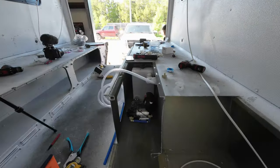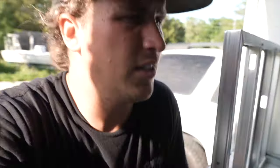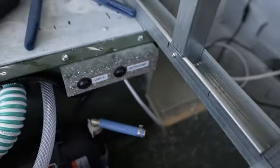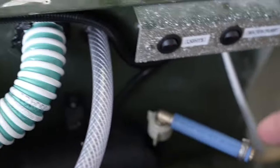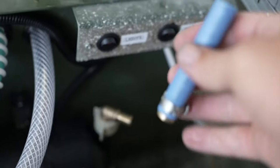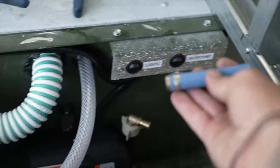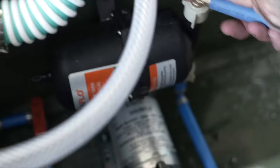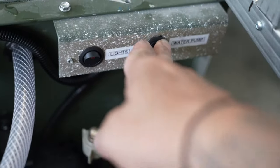Fast forward — I went ahead and fixed the plumbing issue, I hope. I'm filling it back up with water now, so this is the moment of truth. Let's just hope this fitting down there is okay. So far so good. Now that we've made sure there are no leaks without pressure, we're going to go ahead and pressurize the system and turn on the water pump. I took off the other extension I had, and this one just has a cap on the end of it, so I'm going to run this cap over the accumulator fitting for right now and put on the water pump.